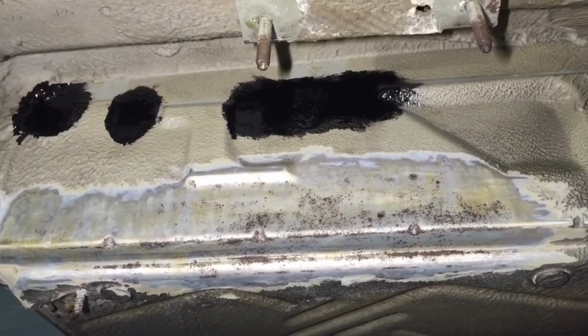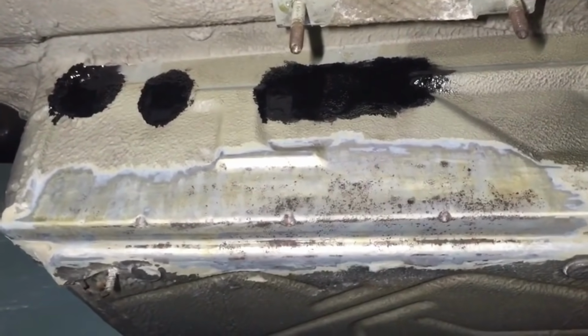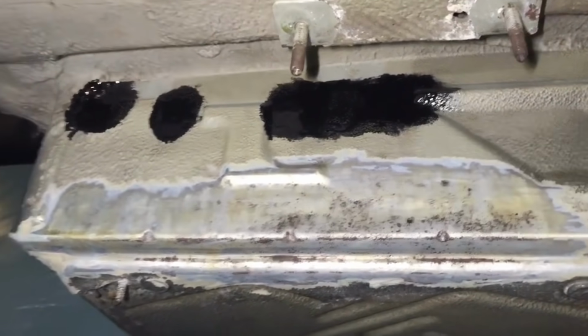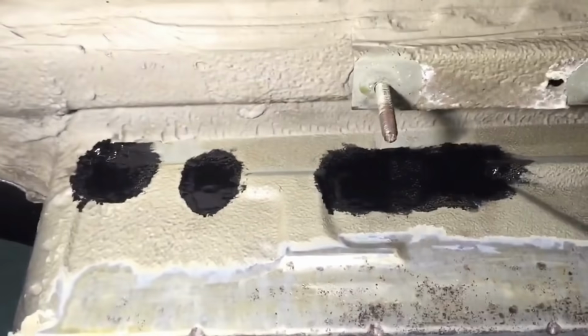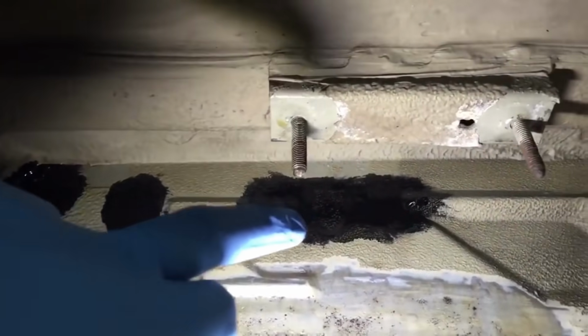The corrosion sits in there. You can clear the tops, but you can never clear all the corrosion from behind it. So we take it off. We belt sand it, a mixture of belt sanding and drilling through the spot welds to remove that bracket, because the only reason it's on there, same with two other brackets up here, one there and connected there, and another bracket over here and here.